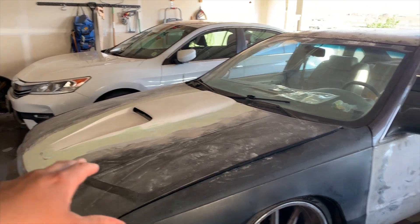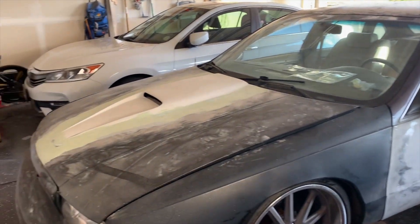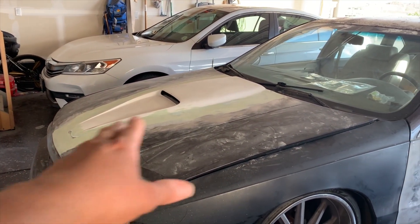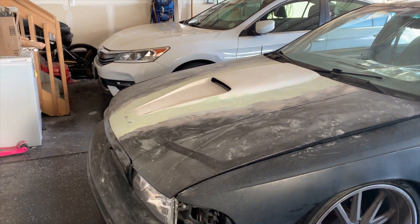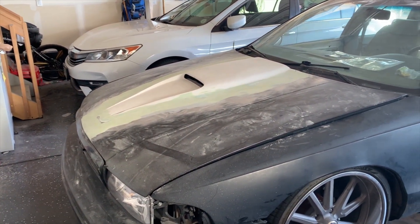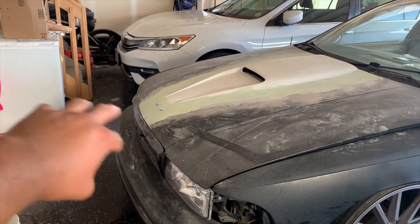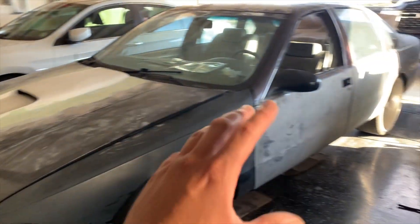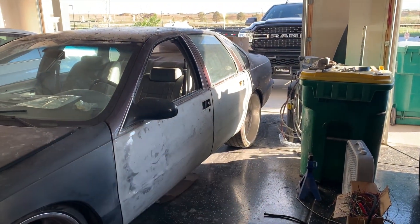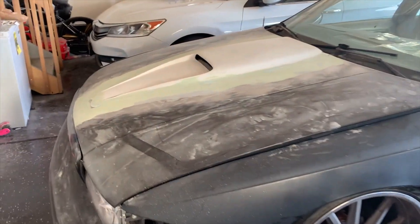This looks a whole lot better sanded down than it did. I might sand a little bit more in the front — I might knock that out at the guide coat stage. I was being a little conservative because I didn't want to start sanding into the grille, so I'll probably take that off. I'd expect the next video will probably cover disassembling everything, fixing those areas behind the wheels on the quarters, and getting it ready to prep for primer.